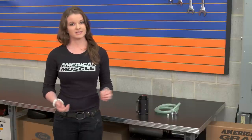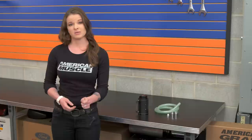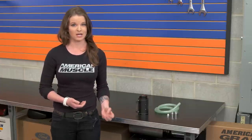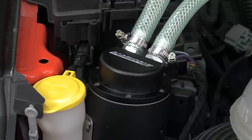The blow-by and the oil mist will settle in the intake over time and they're going to form a gunky buildup. Technically speaking, there can also sometimes be condensation along with the oil mist and the blow-by. And if we let all of this hang out, worst case, the stuff can make it into the oil inside the crankcase. This is not a good thing — it's considered oil contamination and dilution.